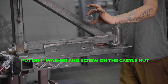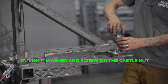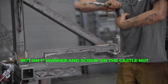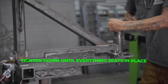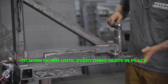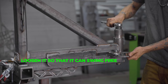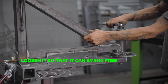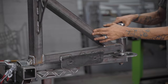You'll find a really big one-inch washer - set that on next. This is your castle nut; it goes on. You can use a pipe wrench or a crescent wrench, whatever you have - I happen to have my giant socket that's made for hubs. You're going to want to tighten that down, get it as tight as you can get it, making sure everything seats in good. Then you're going to loosen it. You'll kind of get a feel for how tight it should be - there should be a little gap here, and it should kind of swing free but not too free.